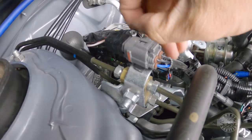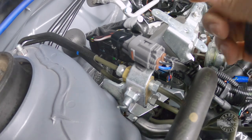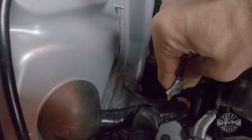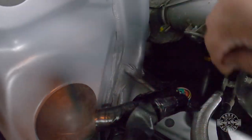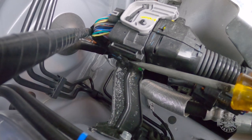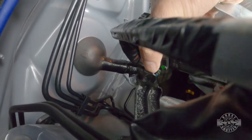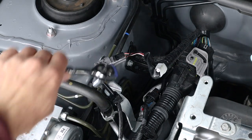Grab a small razor and cut the tape securing the O2 connector in place — be careful and only cut the tape. With that same razor, cut a slit on the folded wiring bundle. There's a narrow empty gap in the middle — that's where you should be cutting. Take the tape completely off. Behind the harness, find where it attaches to the bracket, use a flathead screwdriver to pull the tab, and pull the harness out of the bracket.